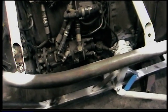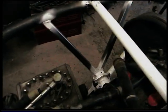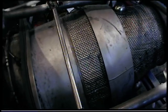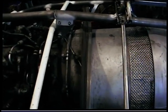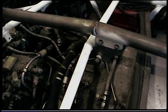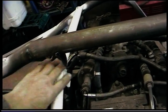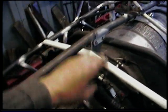The engine mounts — there are technically only three mounts on this engine: one on each side as you can see there, and one under the back, a bit difficult to film, but it's right under the tail piece. It tells you that it only has a five-sixteenths — eight-millimetre bolt through it. So just to be sure, I've picked up on the hoist mount point there as an extra point and also to help stiffen these structures which will be anchored to it. There's another bracket — a little supporting point for lifting — so I shall anchor to that also.